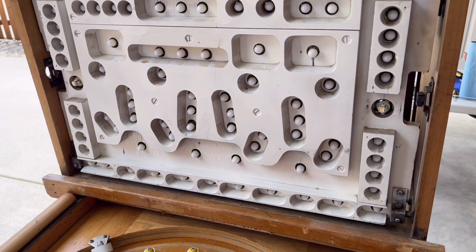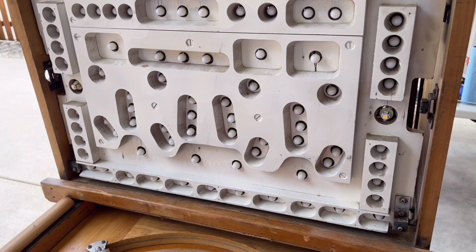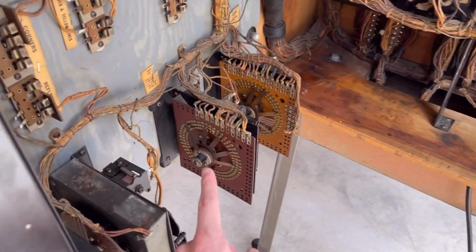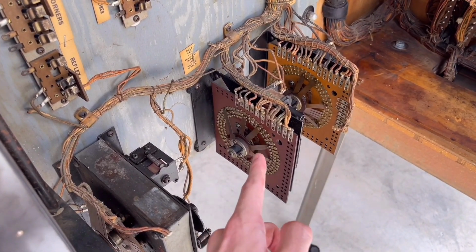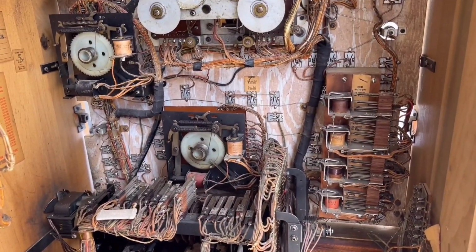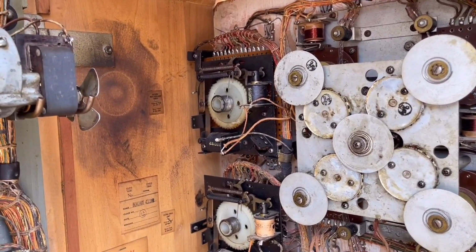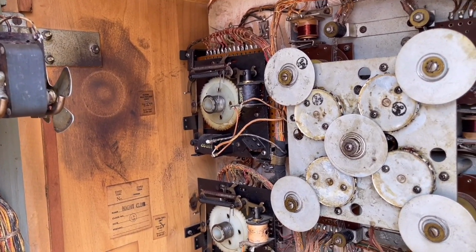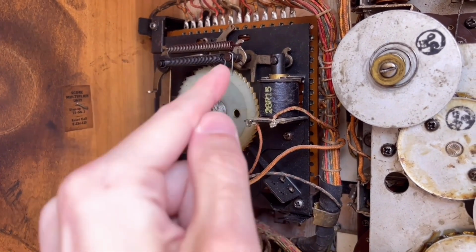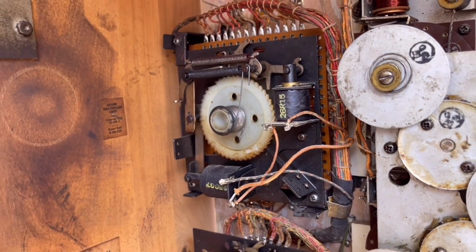And it will only do that under two conditions. The first one being either the red or yellow line unit is stepped up to at least double, and the timer unit right here will be at its fourth step. So as long as the timer unit is at its fourth step and one of those units is stepped up to at least double, the machine will activate the score multiplier unit, just as it says it will do in the manual. And so when the game is searching for wins, this unit will go step, step, step, back, step, step, step, back. And it will do that constantly.